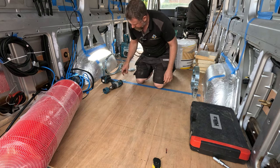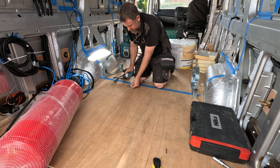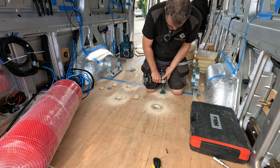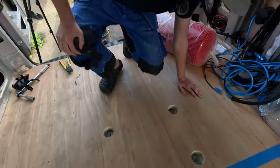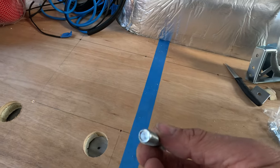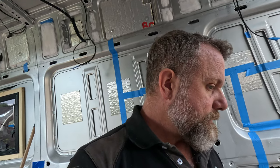We have got our four holes that have popped up. I've got to get one of those plates through each one. I saw in the picture on the instructions that people were just using a hole saw - I was going to use a multi-tool and cut really nice neat square holes, but you know what, no. I need to size those up to take the M10 bolts, so I'll get a 10mm bit, size those holes up a little bit more, quickly spray them, then have a cooling off period while that dries before putting them in.